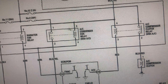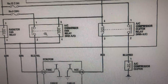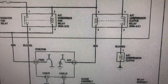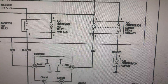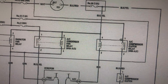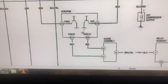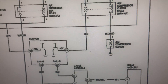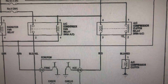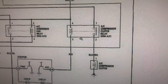The trick is: put the AC on. If your fans come on right away, that indicates the system is kicking in. Most likely your relay is bad, or the compressor is bad, or your computer is not supplying the ground to the relay. Check ground here, check power here — power should be there all the time, just waiting for the ECM to give it that ground. There are a lot of things in there like a pressure sensor for the computer to engage. Check your relay and fuses before anything else.